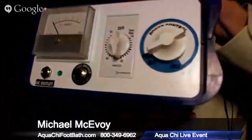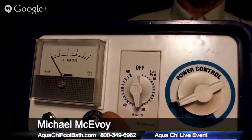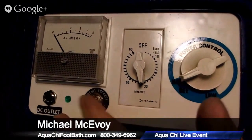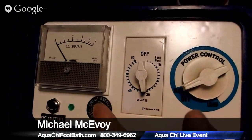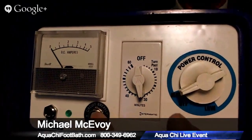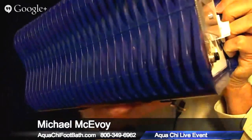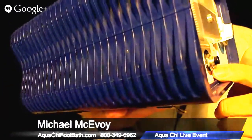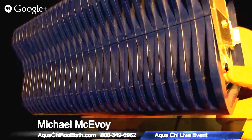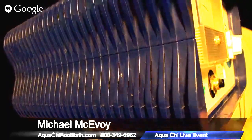The only other type of fuse that we have in the box here is this circuit breaker. Let's see here. Circuit breaker here. Now this, when it's working, should feel loose and have a little spring to it, okay? I'm going to try to turn this sideways. Okay, so you can see here, it's sticking out about an eighth inch, quarter inch, and it just has this kind of feel to it. You see that? So this is normal.